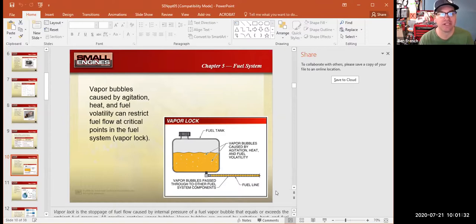Nowadays, we're seeing air injection coming back sometimes, but it's electric and it only runs for a few minutes when the engine's cold and certain things. So why I say it's like a 1970s car is because in the 70s, cars had to meet emission standards, but they didn't have advanced computer controls yet. They didn't have fuel injection. So they added on all these parts, the EVAP canister, the air injection pump, catalytic converter. So that's what you're seeing on these engines.